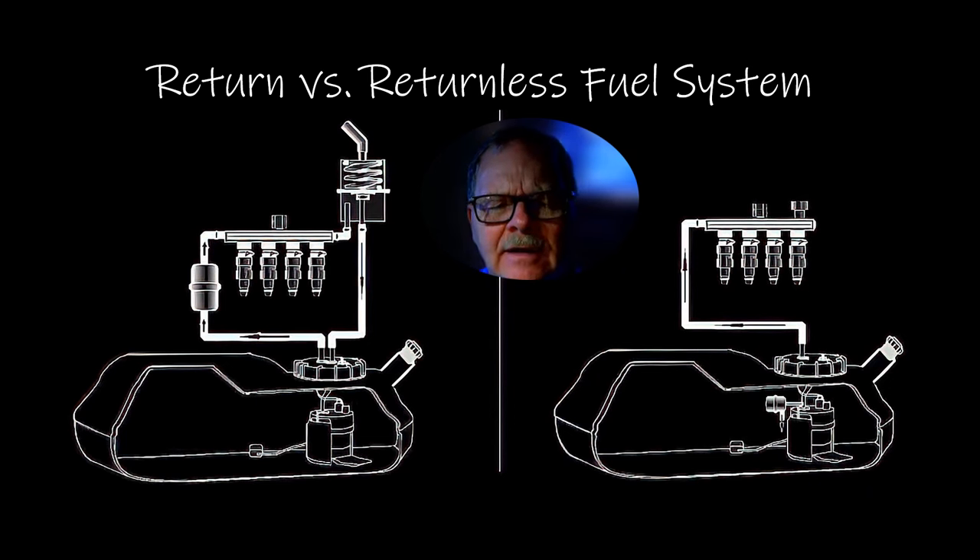I had another one — a mid-'90s Lincoln Town Car with a 4.6, sitting perfectly level, with a cavitating fuel pump creating air bubbles. It had a funky idle. When I hooked the SBDS machine up, it had a walking skip that would walk through the firing order — 1, 3, 7, 2, 6, 5, 4, 8 — and then start over. I called the hotline and it stumped them. But when I looked at the fuel pressure gauge it was bouncing, and I said that means there's air in the fuel. I put a fuel pump on it and took care of that rough idle. The car only had 15,000 miles on it and had been traded in because the first owner didn't like that rough idle, and the Lincoln Mercury dealer couldn't figure out what was wrong. Our dispatcher bought it, had me look at it, and I finally figured it out.